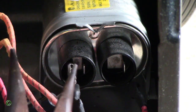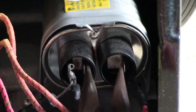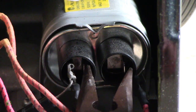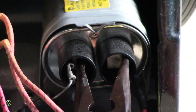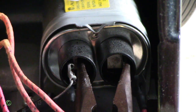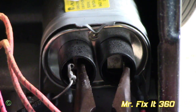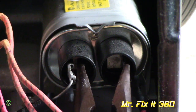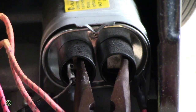The next step is to push the probe's two terminals into the capacitor terminals, like this. Touch them and hold for a few seconds until it discharges — until it shorts. By doing this, it will discharge the current inside the high voltage capacitor. Once it's shorted, there will be no more current inside.